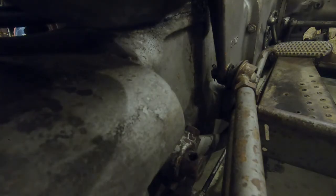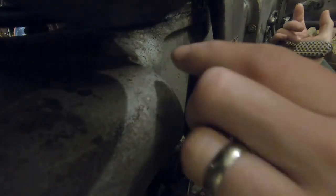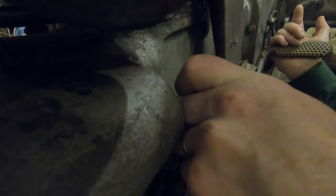Now I just take a cheap screwdriver and stick it down through the hole at the top. To tighten it, I'm going to move this clockwise. From experience, small movements mean big changes in pedal travel, so I'm not going to have to turn this very far. I'll kind of hold the pedal and then try to turn this clockwise.